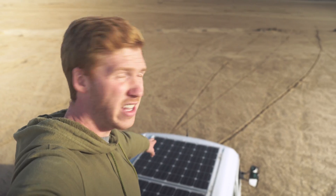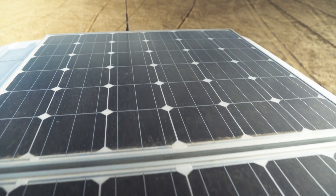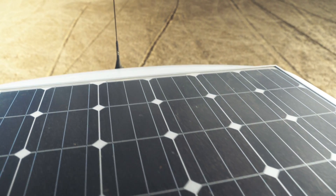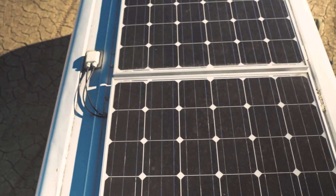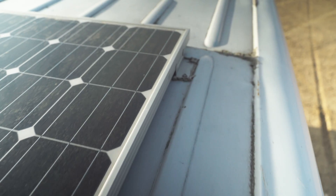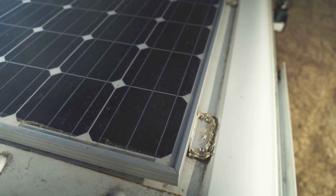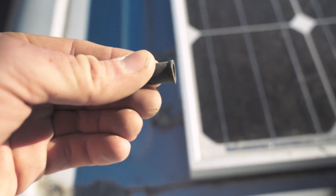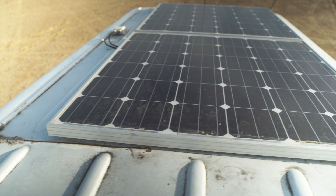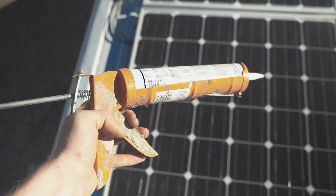I got these two Renogy solar panels — they're each 150 watts, so that produces 300 watts total. Some people stick panels onto the roof with double-sided industrial 3M tape. What I ended up doing was drilling holes into my roof because I wanted something guaranteed to not get ripped off by the wind. I used expandable washers that fill the holes so I wouldn't have to worry about leaking, and just to be doubly secure I used lap sealant around the edges.